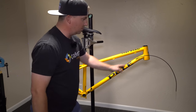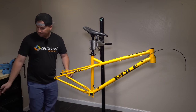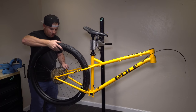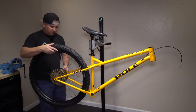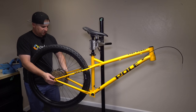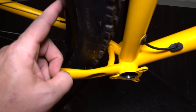They've got big oversized ports so you can fish it out with some needle nose. This bike's a 29er — it can also fit 27.5 Plus. Let's see if it'll fit a 29 by 2.6; I've got a 29 by 2.6 Specialized Ground Control tire here. Oh my goodness, no problem — tons of clearance for a 2.6. This is interesting: it says 142/148, so that means boost or non-boost, which is cool if you have non-boost wheelsets. On this side we probably got closer to 3mm clearance, which is tight, so I probably don't recommend 2.6s if you ride in mud.